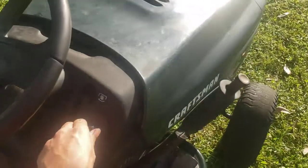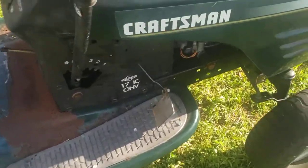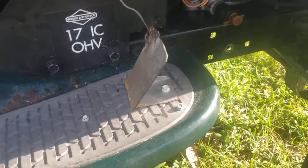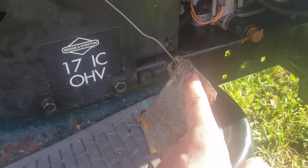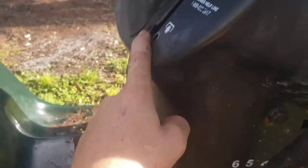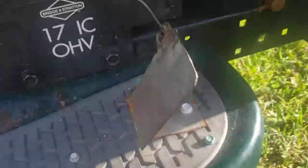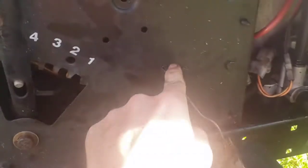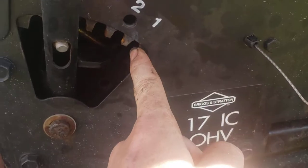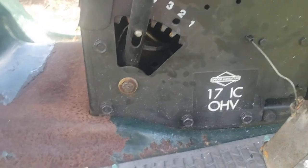Somebody in the comments said making a gas pedal is fun, but if it works it's even better — and you know who you are. I made a gas pedal, it was fun, and it works. It was very simple. The deck engagement lever — I actually made out of an exhaust cover, like this steel piece. The cable ran through it; this hole was not here, you have to drill that. You could run it through here, or you might be able to pop it here, but then the gas pedal would have to be closer. That's how I did that on this LT1000.